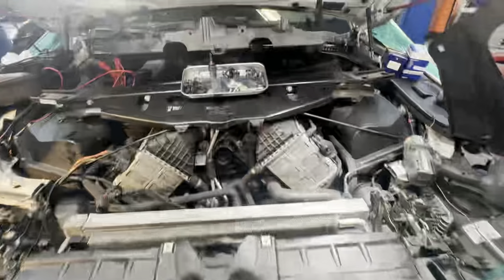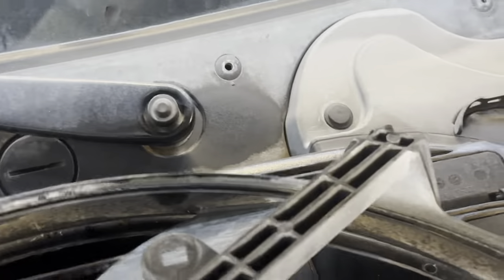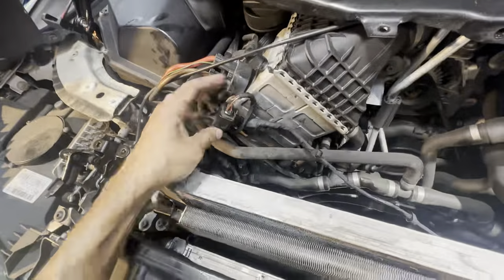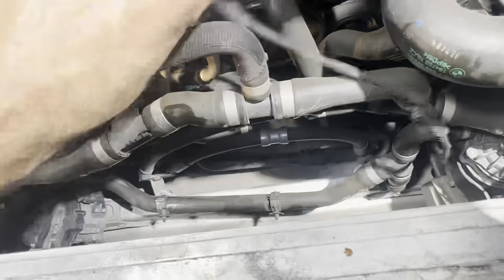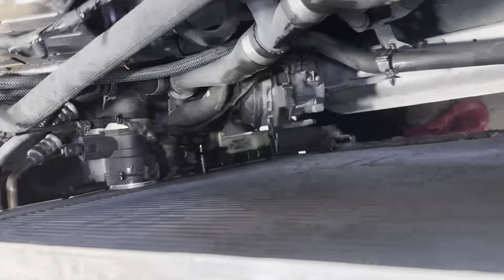Next thing is to remove the radiator fan. There are going to be two clips at the bottom for coolant hoses on the bottom, so you have to unclip those from the bottom. Then just your regular connectors for your fans, and then a bunch of these little clips — just unclip this harness, it goes around right here. Tuck it down behind, then pull straight back. Here's that bracket you got on for your auxiliary water pump, and now you have access to those two cooling pipes right there — those are the ones for the auxiliary radiator that you have to remove.